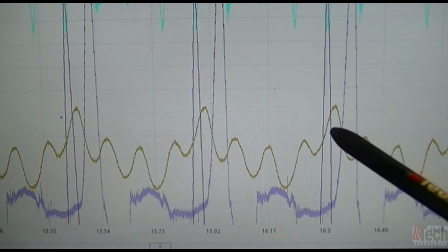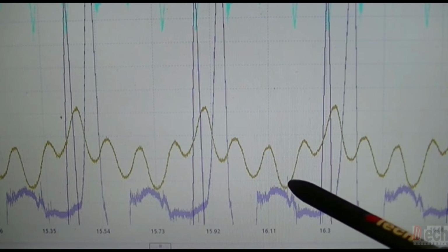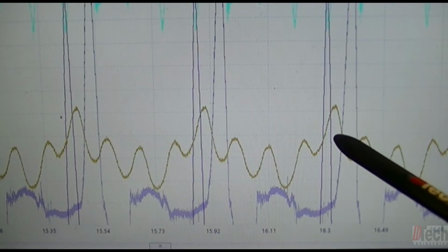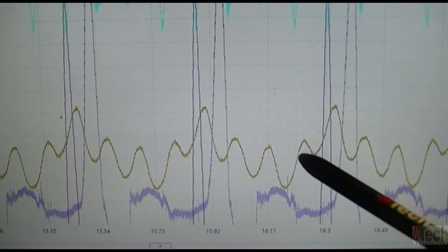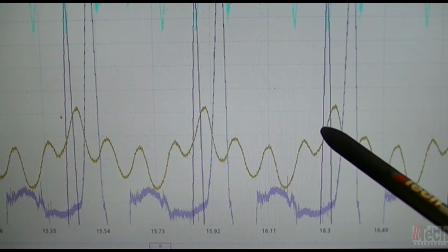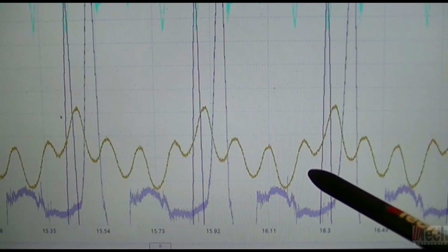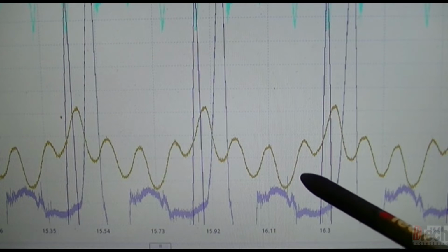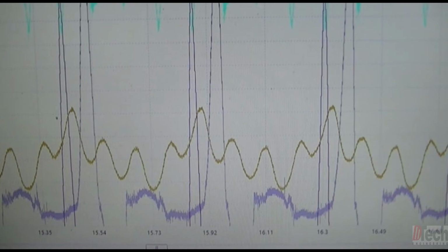So this anomaly is caused not by positive pressure being introduced, not by a delay in intake valve opening, not by crankshaft speed change, but due to a leak in a sealed cylinder not being able to create a strong enough pull, and so the pressure level rises. And so that is what we are seeing here.